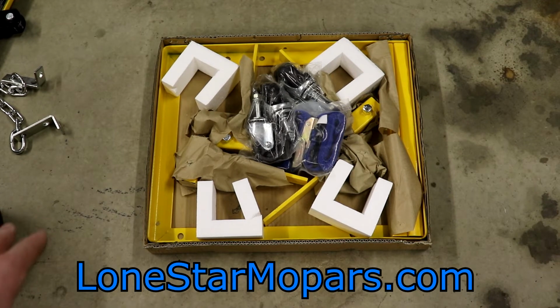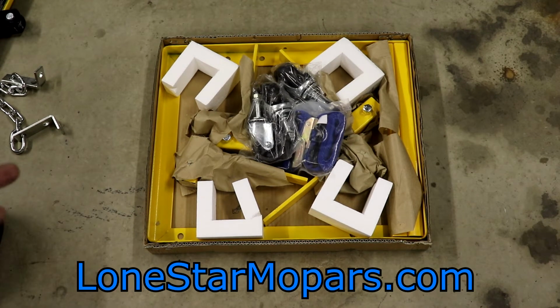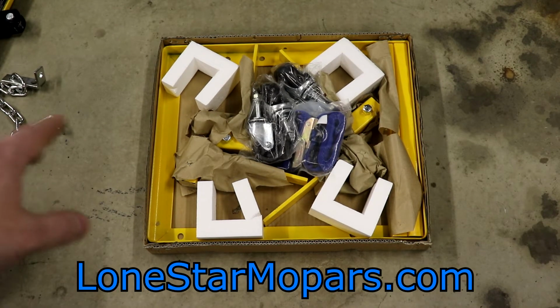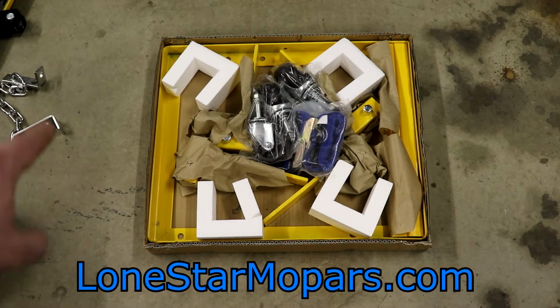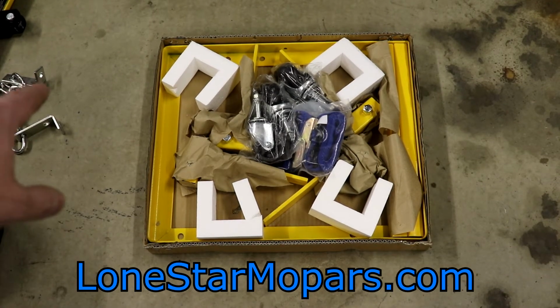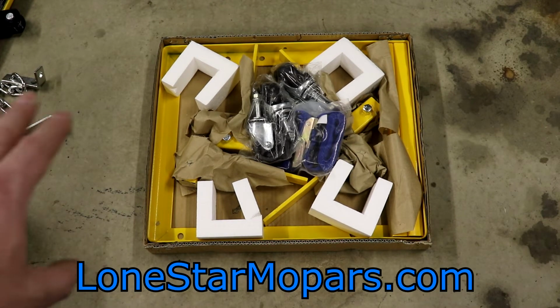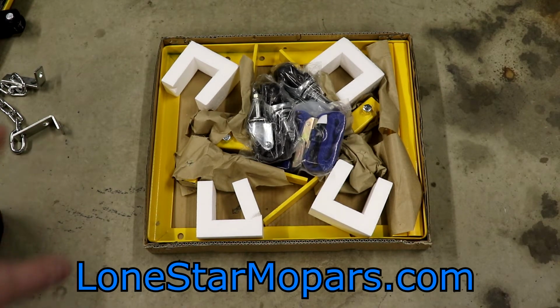But it is yellow. The powder coating is kind of off in that top corner. This is always a telltale sign, the little things. A lot of times, you could run a full bead in that corner for best case scenario, the best strength, right? Or add a gusset type of thing. This is just folded. They did a tack, seemingly offset from the middle towards the inboard side, or to each their own. But the powder coating just takes a little bit more time to get your corners to cover really good. It is difficult, I get it, but like I said, this is the difference between paying $67 and maybe paying someone $150 for this.